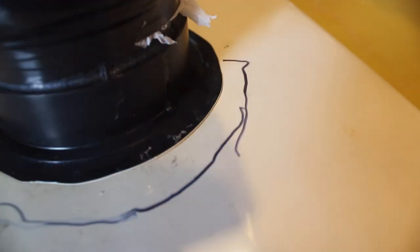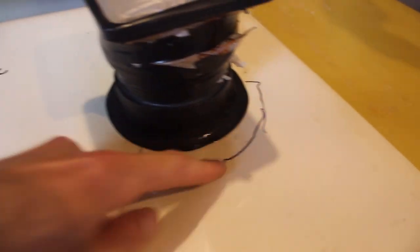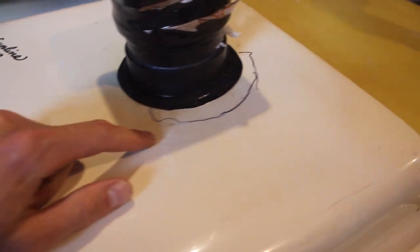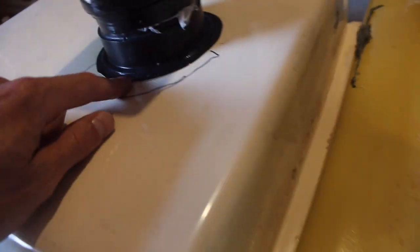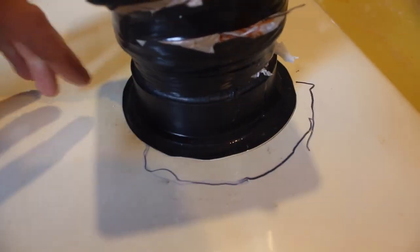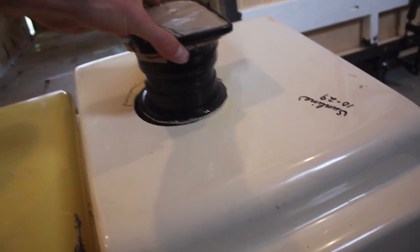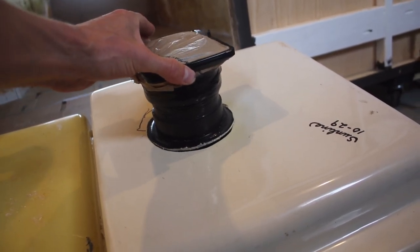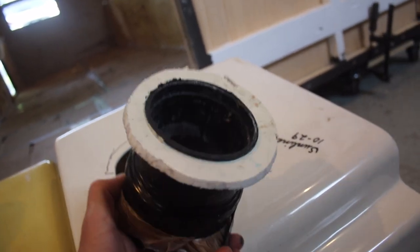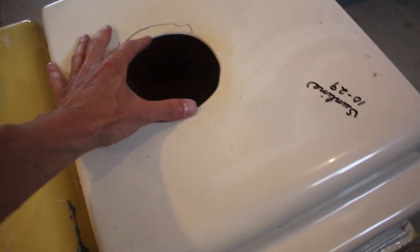You can see where I circled it — there's a hairline crack that goes around the flange; this is where it's broken all the way through, but the crack continues all the way around. So what I'm going to try and do is continue the break all the way through to get a bigger hole and then work with that size hole to redo this piece. That was where the plumbing drain started — it was just glued and cemented in. I cut it right around where the crack was and now I have a four and seven-eighths inch diameter hole roughly.